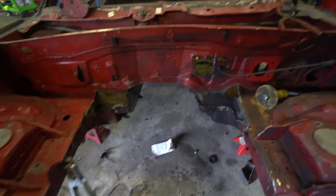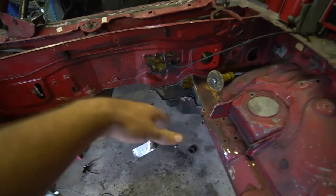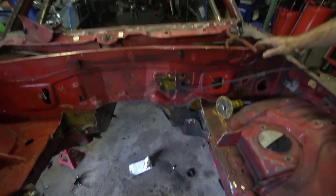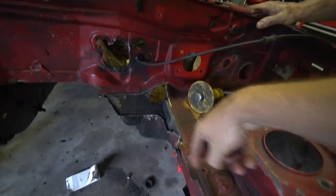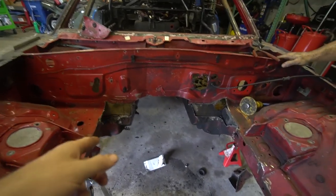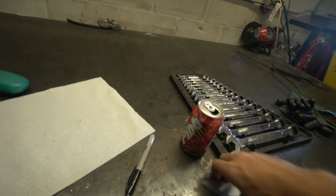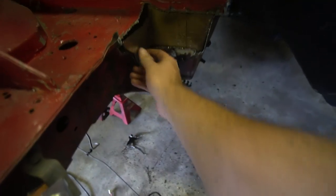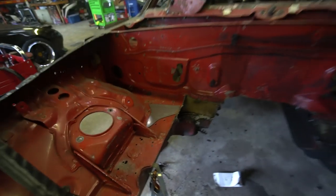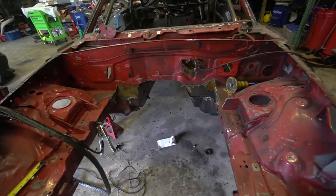The corners being cut out makes a lot more room — mainly for the back of the cylinder head. Pretty much everything; the engine would never fit in here if you didn't cut those out. I cut mine and I think I stopped about here — I should have cut it that far because it's kind of in the way sometimes. We'll need to figure out some cover plates for that. Those actually came in my Monster Miata swap kit and I didn't realize I had them, so I made my own plates.